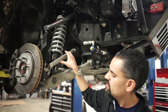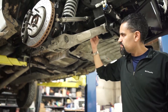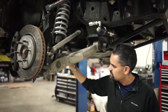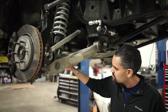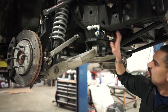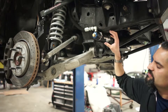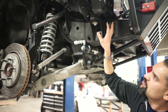So, 2011 Raptor. We've got different suspension than the factory: reinforced spindles, upper cambering A-arm, tie rods. We've reinforced the frame on the back part here with a longer bolt and reinforced 12.9 bolts, and then longer on the reinforced frame here — or the lower control arm points — on both sides, all the way around.